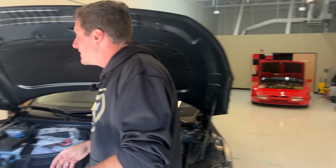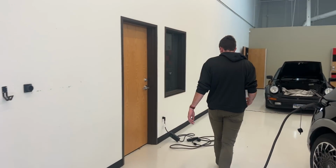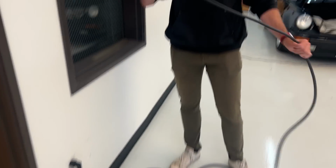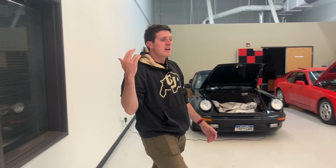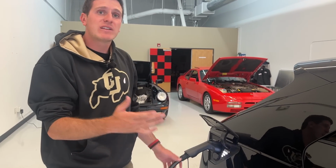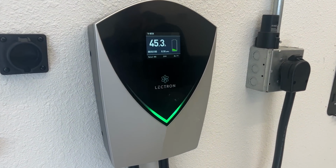All right, so is it worth it? Well, in my opinion, it absolutely is. This is a great example of kind of the different speeds in charging. So a level 1 120 volt system, it will work. It will put energy in your car. It'll just take a long time. A 32 amp level 2 system, it will work much better. It's going to be like 6 times as fast. It'll deliver energy to your car much quicker. But especially if you have a large battery like this Ioniq 5, jumping up to a 48 amp wall box like this is going to be a big, big, big jump.